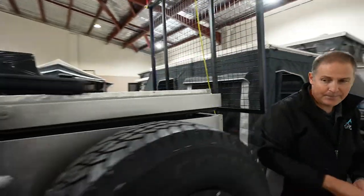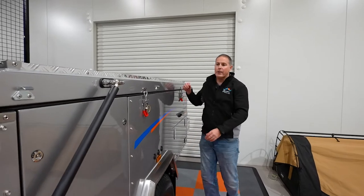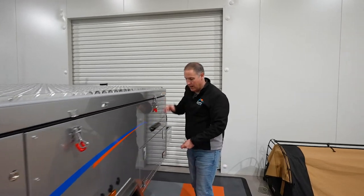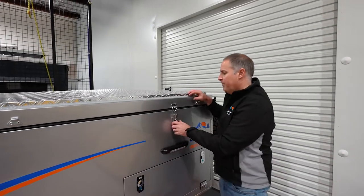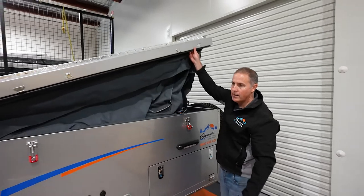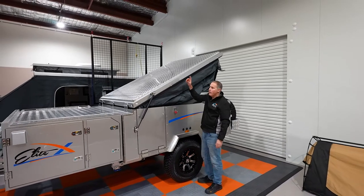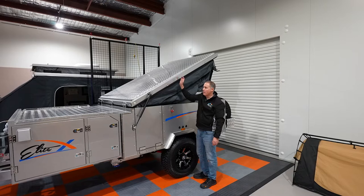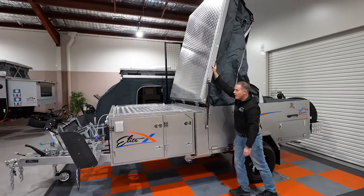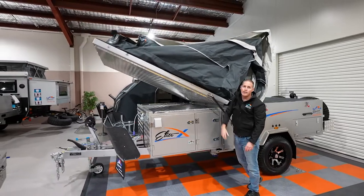Go back around the other side. Just be careful not to lose your little pins. A good little trick of the trade — undo that latch but leave the rear passenger side latch for last. Put a bit of pressure down, and then this guy is going to be spring-loaded. You can get your front winch and winch it over the back, but we find it's generally easy enough just to push this over. Give it a bit of a push — it won't slam down on the other side, so don't worry about pushing too hard.